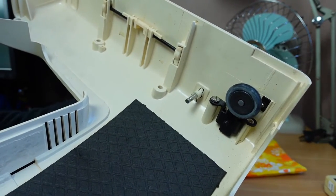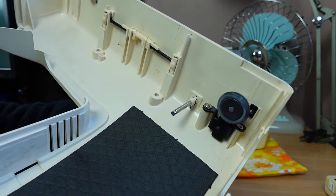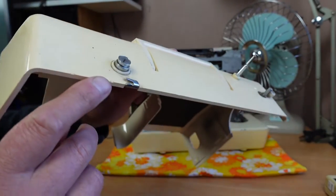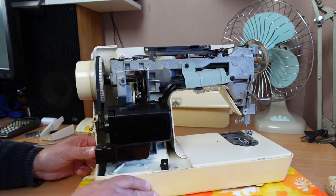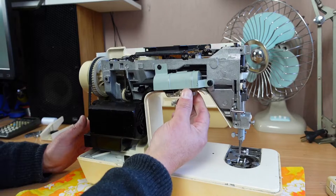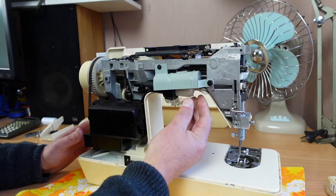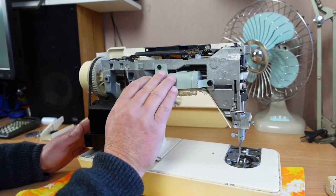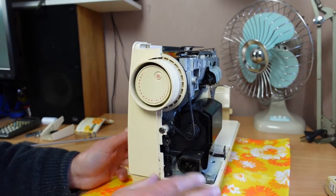Here's a look at the inside of the spool pin — it just drops down like that with a little clip to stop it from pulling right out. There's the bobbin winder tensioner. We've got the motor, drive belt, and bulb. That bulb holder just swings down a little bit like that, giving you access to the bulb for swapping it out. There's also a little bulb shield. Looks like it's going to be quite nice and easy to service.